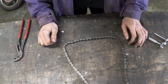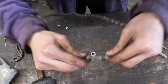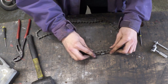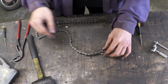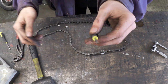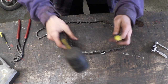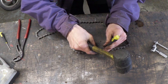So now I'll show you how to put it through the rest of the way. From this point you can either use your little tool to push that pin all the way back in, but if you don't have one you can do this. I've got myself a big M10 nut right here, so I can lay my chain over the top and that gives this pin room to be pushed all the way through. So I grab a screwdriver — this one is specifically a Torx — hold it over the top, try and get it central, and just give it a tap.